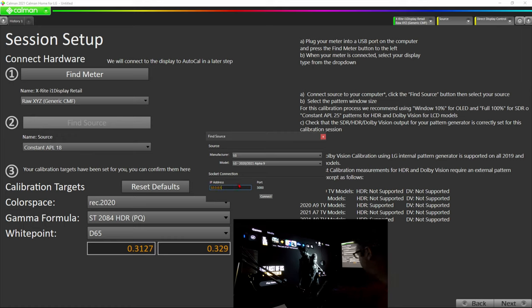Here in your luminance chart, the yellow line is the target luminance curve through your TV's brightness range in HDR, and the gray is the actual performance. You see really good tracking up through about 375 nits with a gentle roll-off at about 730 nits — the C1's peak brightness in Cinema mode. This is a very good result and probably won't get much better with calibration.